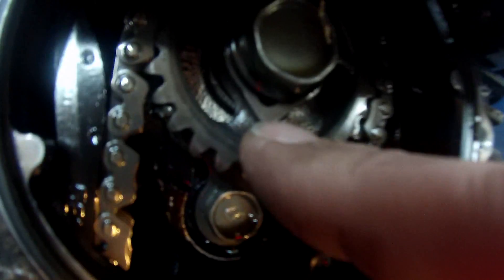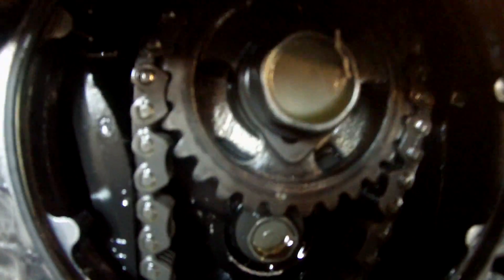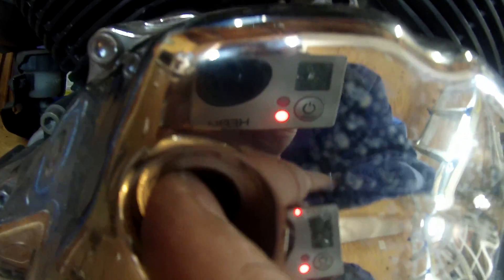We've got to line the top of the cylinder up with that mark right there — with that little arrow that's on your cam gear right there. So that needs to be marked at the top where that little mark is. And inside here you can see there's a little mark on that inner diameter circle, a little cut in it right there. We've got to line that line with the T on the flywheel.